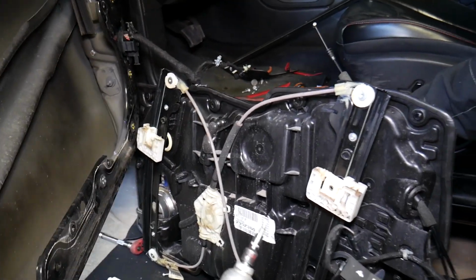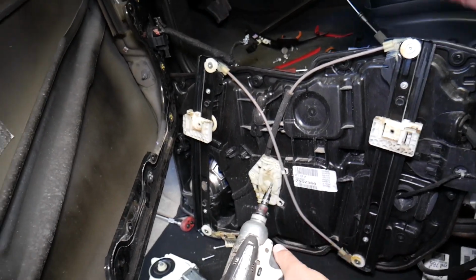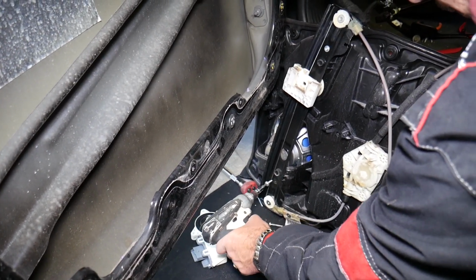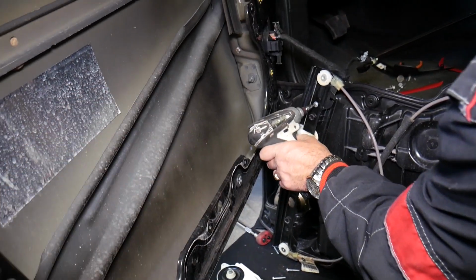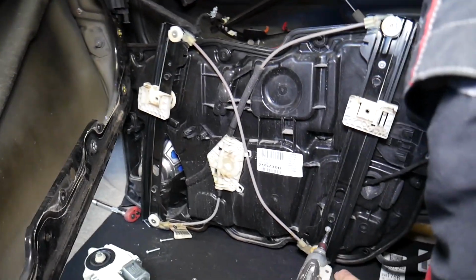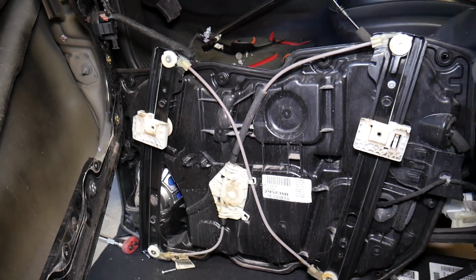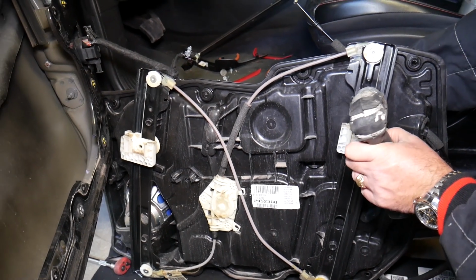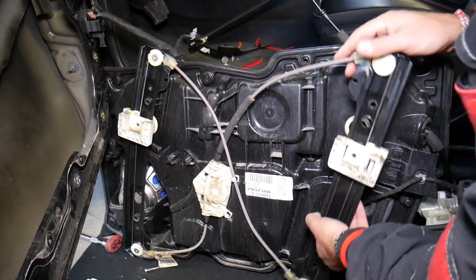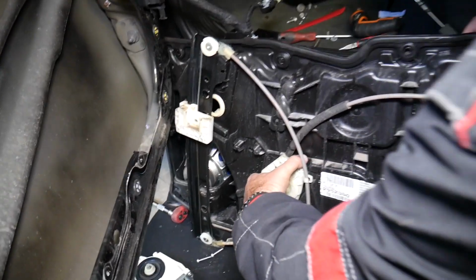So now for the window regulator, guys, we need to get a Torx 25 star looking bit. Okay, and we need to start removing a few bolts. You need to make sure that you install the cables later the same way. There now. If you need to buy a new window regulator, we'll have the link in the description. Check it out, guys, it will be for your convenience. Two more here. Okay, perfect. One more over there. Check out how much grease it has, that's good. Now you grab it, guys. The only thing holding is the window motor here, where it attaches to that panel.